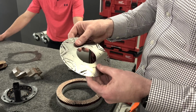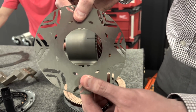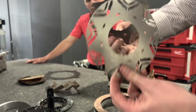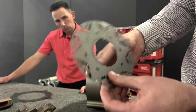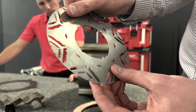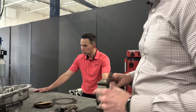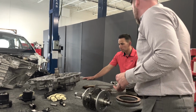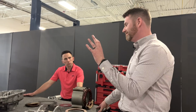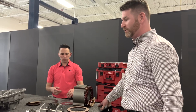Let's see here if I align these correctly. So this is common, and you can see here essentially where it is blocked, and you simply flip it over, I believe here, to get them to line up. So it's a common part, and just clocked differently to allow for the cooling paths with the rotor itself. So that's something that we thought was pretty interesting. So a lot of emphasis on, I think, quick assembly, accurate assembly, cooling the overall assembly itself.